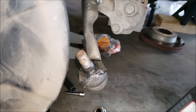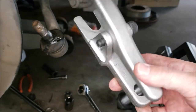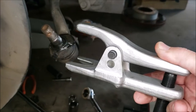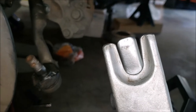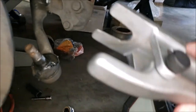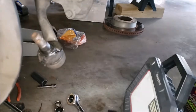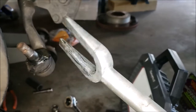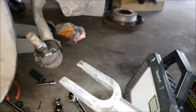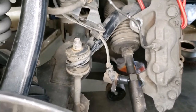This tool — you can find it at your local auto parts store or online — works pretty well because you can slip it underneath the boot on this end and it'll force it out. I really should have started with this before beating on it with the mini sledge. Another option is the old pickle fork, but if you use that it's going to mess up the boot more likely than not, and you'll have to get a new tie rod end anyway.